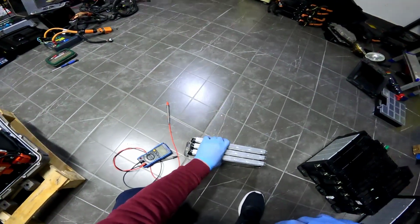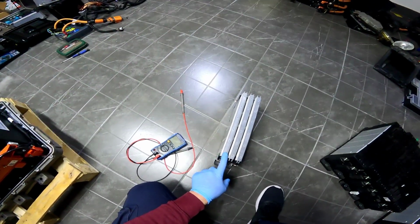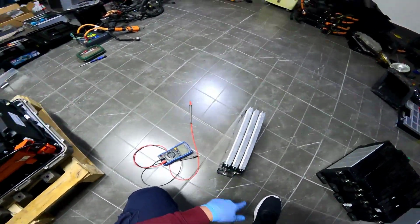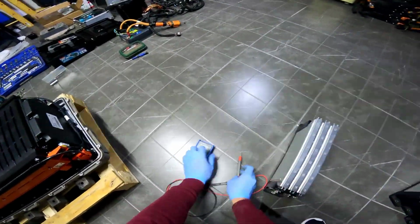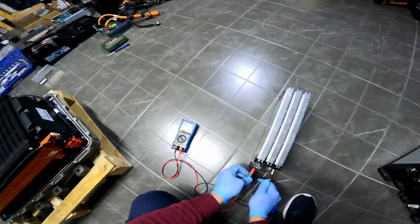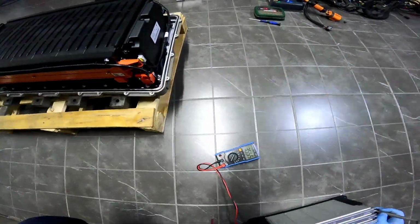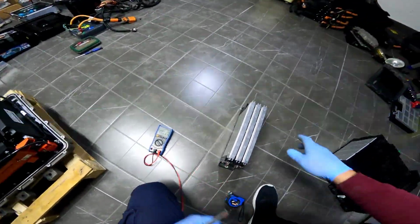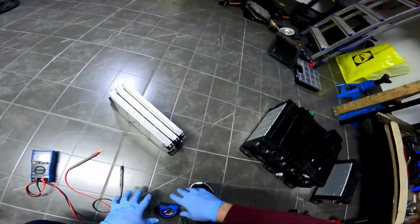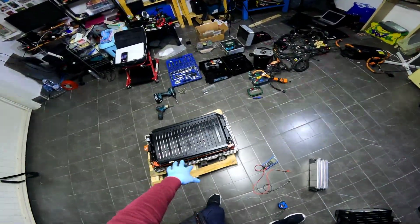As I was telling you first, they're rated 3.7 volts, 14 amps. We have 1, 2, 3 that are parallel together. And these first 3 with the other 3 are in series. We already saw we have 7.10 combined with a 3.55 on every cell. Okay. That's because they're not fully charged. I have about 91% state of health in here, much better than the ones I have here.